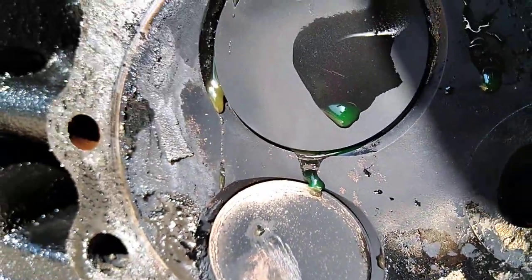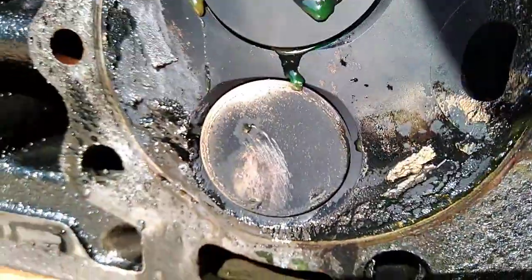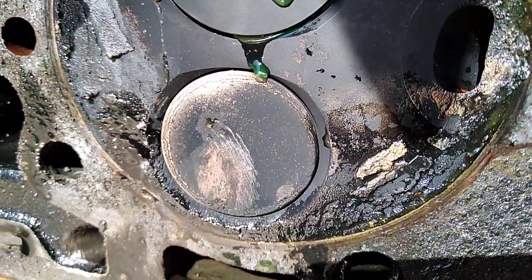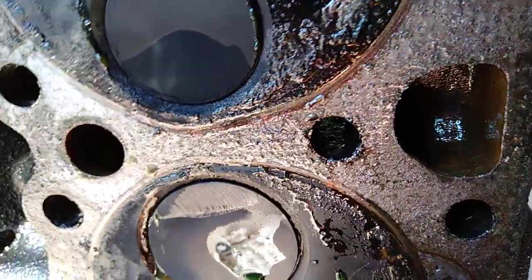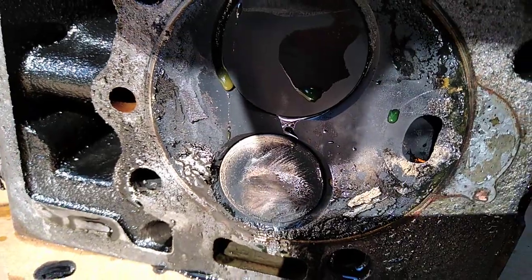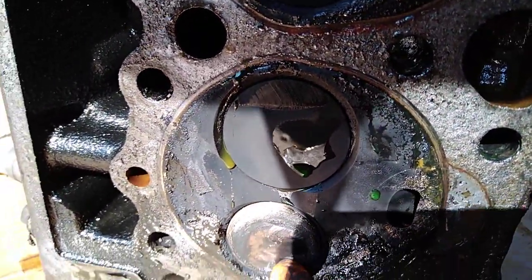You can see this valve right there in the back — it's like that, and that is because my push rod was off kilter on my rocker arm and it wore a separate groove in. Geesh, that looks like some wear. I wonder if that's been hitting the piston. I'm going to have to look at that. It doesn't look damaged or anything.